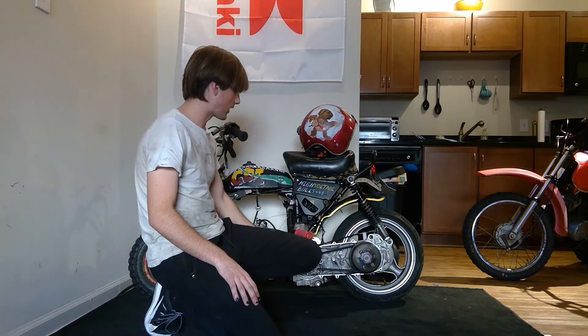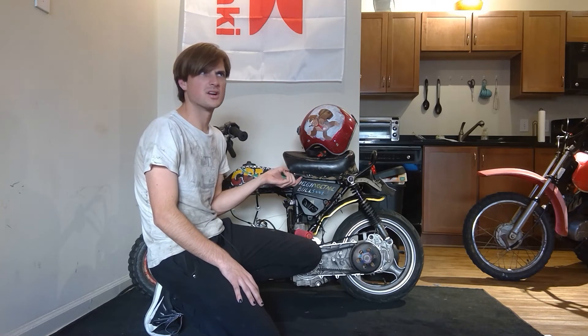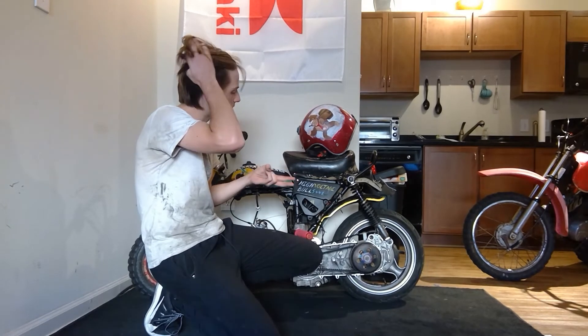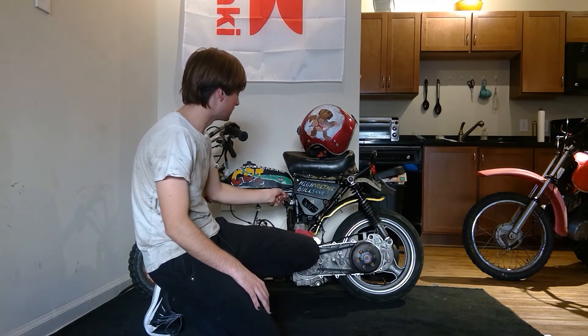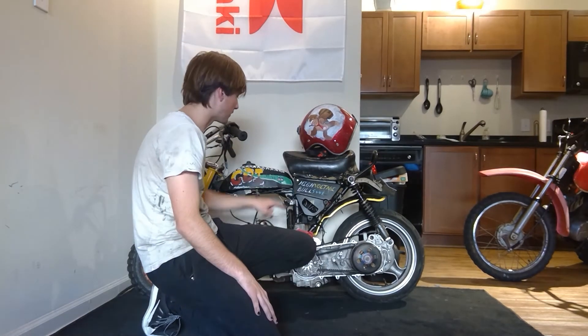None of it's fused, obviously, because that takes way too long. For this engine, the only thing I really kept was the hall effect sensor and the stator — everything else I put together. It's got a CDI box from some crappy 50cc quad. The starter solenoid is actually from the scooter. This coil is just some piece of junk I found at the junkyard. All the wiring — from the headlights that work when I want them to, to the ignition — is pretty much done by me, and I have this awful huge clump of grounds bolted right here.